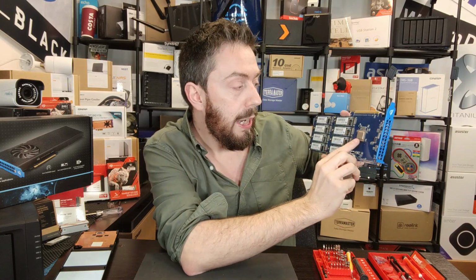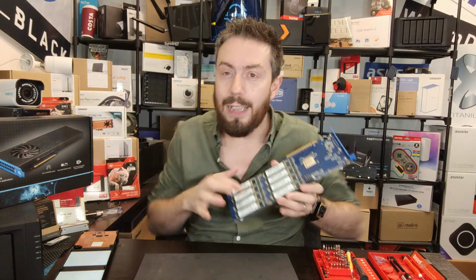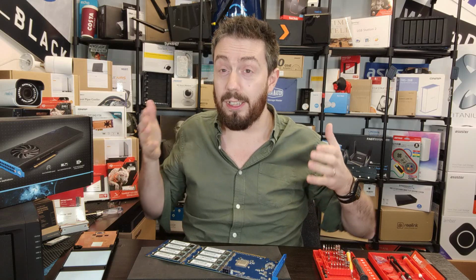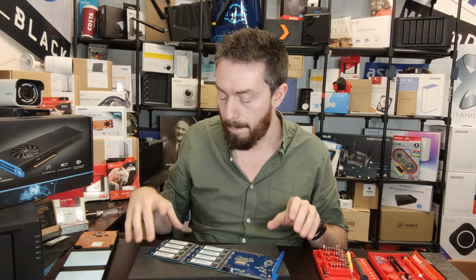Also, it's worth highlighting that Broadcom controller inside. That is, frankly, where the magic happens, because just having super fast SSDs inside this is not going to be enough. It just isn't. You need good management. Having a good CPU is going to help when you're running, whether it's real world or synthetic benchmark testing with AJA and Atto and stuff like that, and Crystal Disk that we're going to be running in the next video. But this card needs to have its own PCIe switch and onboard controller.